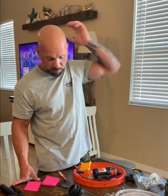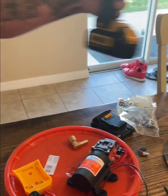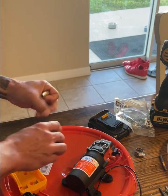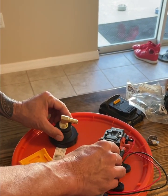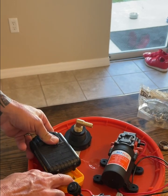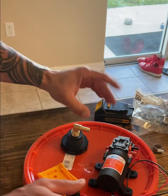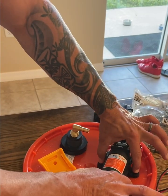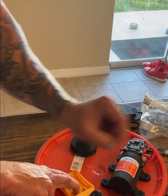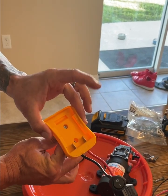I'm sitting at less than a hundred bucks with all this stuff, so not a big deal. I'll show you basically what I'm going to do. I'm going to cut my hole out, and you want to line everything up properly before cutting — make sure you're lined up so the feed goes directly from here to here. Also make sure you have space to remove the battery, because you'll bump it if you place it wrong. Lay it all out first to get an idea of how you're going to do it, then cut your holes. These have four holes — I'm just going to use regular screws, and when it goes out I'll just remove them. Make sure the screws go down inside so it's nice and flush for the battery to lay inside.